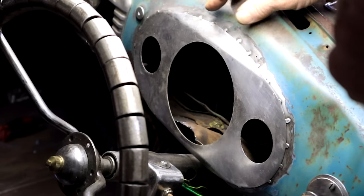Let's see if the brake lights work. Yes! That there is my brake light switch — I actually stole it out of one of the wrecks standing in my yard. When you step on the brakes, the switch closes and the brake lights work. Stop light wiring is pretty simple — it's connected directly to battery supply. Battery power flows through the main fuse to the fuse box, from there on to the brake light switch mounted on the pedal assembly. When you step on the brakes, the switch closes and power flows to each of the lamps in the back. The fuse is basically to protect the circuit.